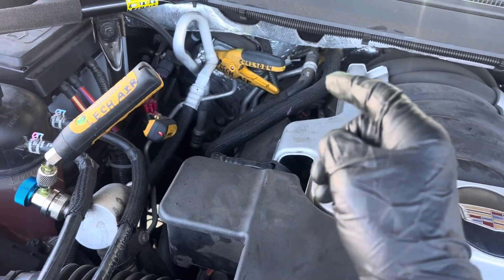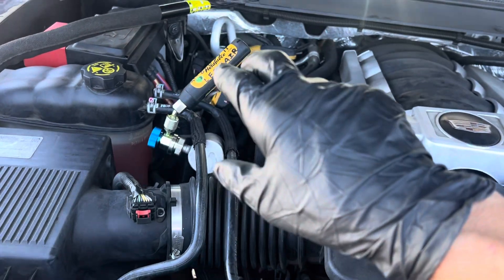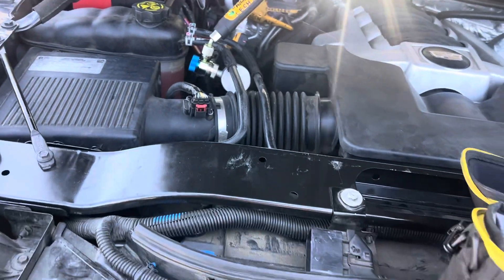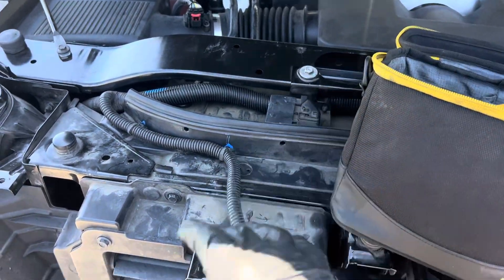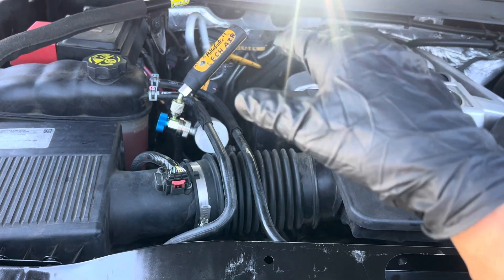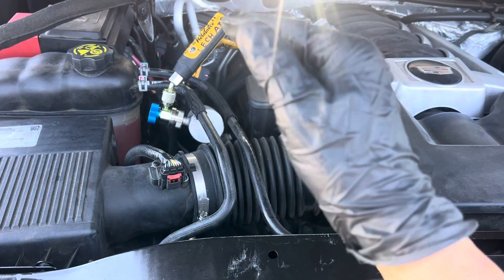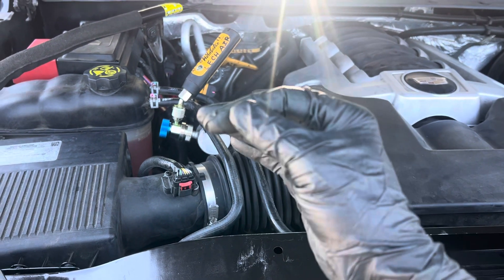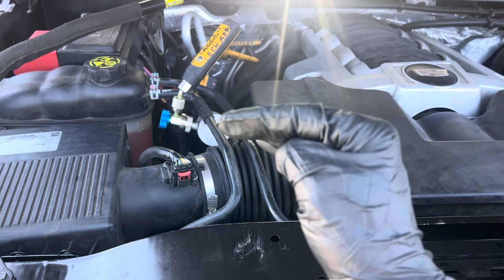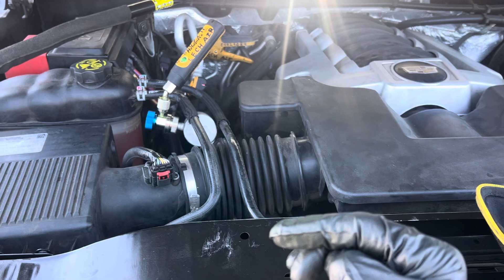This is our fifth or sixth video on the 2015 Cadillac Escalade Platinum. I've taken you all the way from the very beginning steps, showing you deep vacuum, throwing two vacuum pumps on it, the difference between the micron level as it went down by adding the second vacuum pump. But remember: the farther you get down in vacuum, the harder it is to lower it — the more energy and time it takes to achieve that lower vacuum.